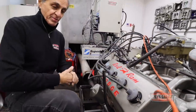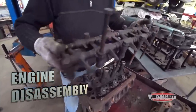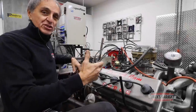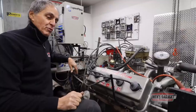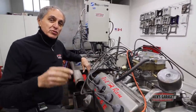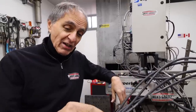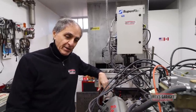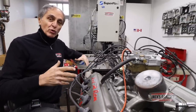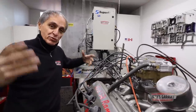And then I had another issue yesterday because when I had the engine running, I said, let me check if I got oil on the rockers, because these are non-adjustable rockers and they were very, very gummy and dirty. So I took out the valve cover yesterday. We ran the engine without the valve cover, and I noticed very, very small drops of oil coming through the rockers. So Vasily and I took off all the shafts, dismantled everything, and blew air and cleaner through every little rocker, every little pinhole, which took us time, to clean the shafts inside out so I could get more oil fed through the pushrods to the rocker assembly. After that was done, we put it all back. Then we made a run just for a few seconds and we finally saw the oil splashing out everywhere like it should. So we put the valve cover back on, then we did a few tests, and then we took it from there.